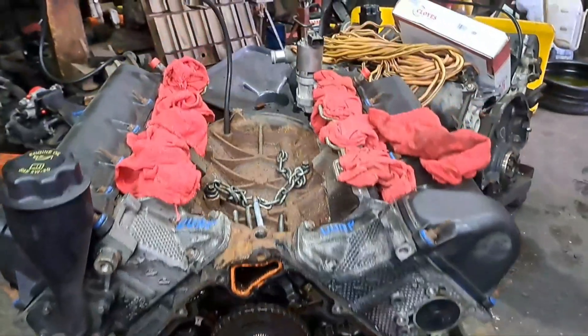The timing chain has three of them total. You have one that runs to the jackshaft - this isn't a 1:2 ratio, this is a 1:3, so it takes three turns to get one turn out of it, because the rest of the ratio is involved in the cam gear up on the camshafts. The timing marks are a little weird - it doesn't have conventional timing marks. It relies on you to look at something that lines up with the corner of the cylinder head, so it's a little tricky.